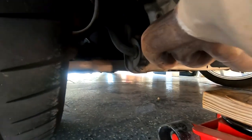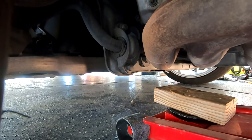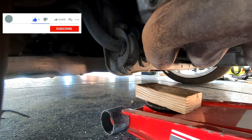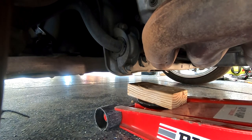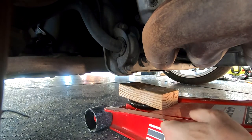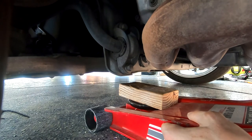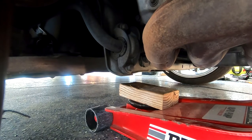I've seen online several ways to jack up a 911 — some good, some bad. The 911 has factory jack points, but once you jack up the car you might not trust the jack will keep the car up. I feel more secure with jack stands versus my hydraulic jack for long periods of time. I never had an issue, but better safe than sorry. Don't ever jack up the car by the engine or the oil pan.